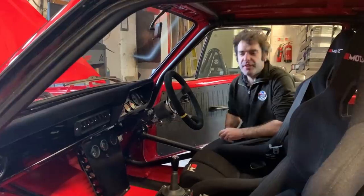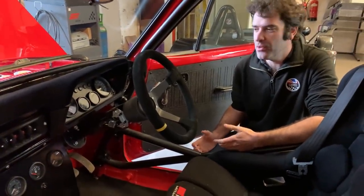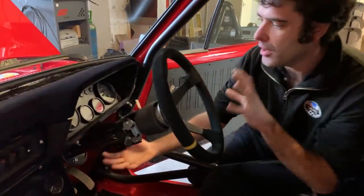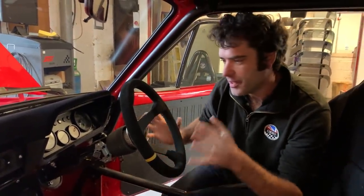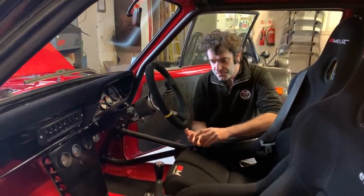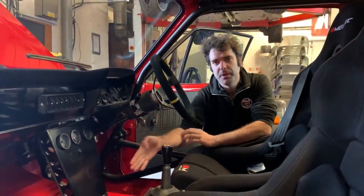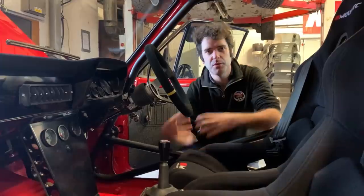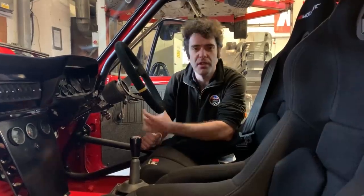Looking inside the car, this is still very much the first prototype, so there's still a bit more refinement in terms of trim and detail. Engineering-wise, we've done a whole new column with all the correct steering locks, coupled to the power steering motor. We've altered the steering and driving position slightly to make it more ergonomic. The tunnel has been modified to allow for the modern drivetrain, including a redevelopment of the gear linkage — the standard gearbox position was too far forward, so we've designed and engineered our own billet shifter that moves the gear linkage back and gives a nicer, sharper gear change.